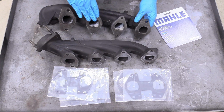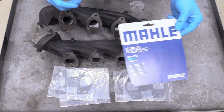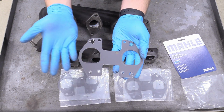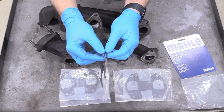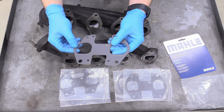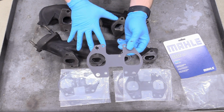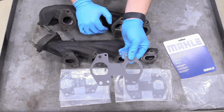I've already cleaned off this mating surface on both of my headers here, and then I also want to talk about our gaskets. They are made by Mahle, and as far as I'm aware, right this moment, they are the only ones that make this kind of OEM style gasket. You might be able to get them straight from the dealer, but I don't want to pay dealer prices. This is a metal multi-layered gasket. See, it has 2 layers on there instead of just one. They make ones that are just like a composite one-piece gasket. I haven't had a ton of luck with those lasting and going the distance, but these metal ones always hit the nail on the head, and they are my preferred part for putting on manifolds or headers or anything like that. I much prefer the metal ones, so the link is down below in the description for these guys for you. So let's go ahead and install them.